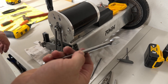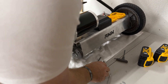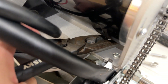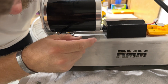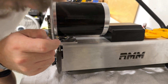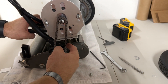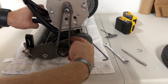You're going to need your 13 millimeter box wrench and a pair of needle nose pliers. The easiest way to tighten the tensioner once the bolts are just slightly loose is to go from the back side right through here and grab the top of the nut with your needle nose pliers. Then come around to the front, take your 13 millimeter wrench, and turn this nut clockwise while holding the bolt — you can see that's tightening up the chain. As far as chain tension, you want to see about a quarter inch of deflection in the middle.